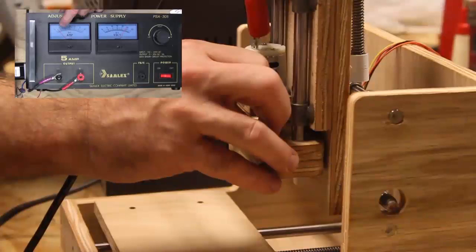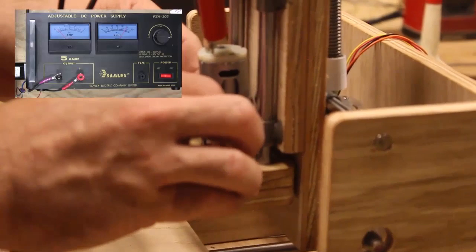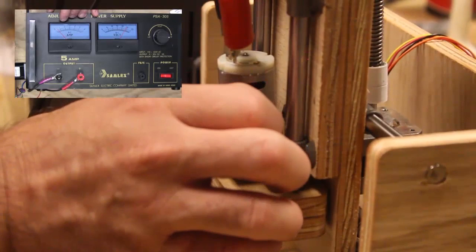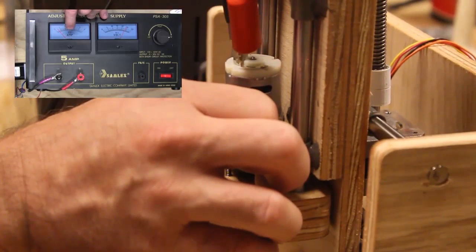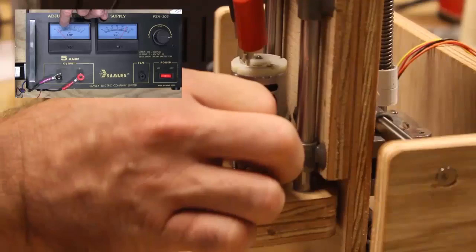This effect is even more apparent with a 12-volt motor. You can't make the amp draw go lower than its natural minimum because at top speed the spindle tends to seek its proper alignment position. If you don't have an amp-reading power supply, you can still do this by ear: listen for the motor speed dropping and a binding sound as you twist the assembly. Every time it binds you'll see the needle wiggle as it pulls more amps. Let it seek its own level.